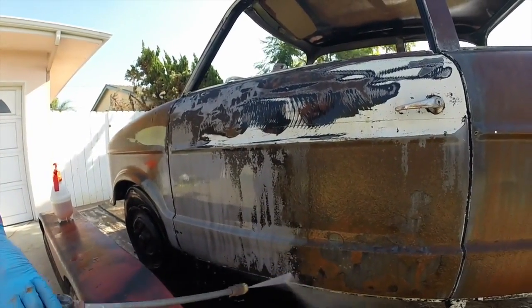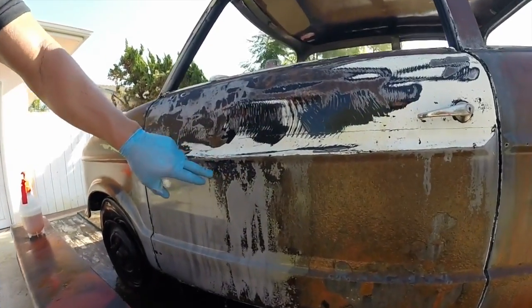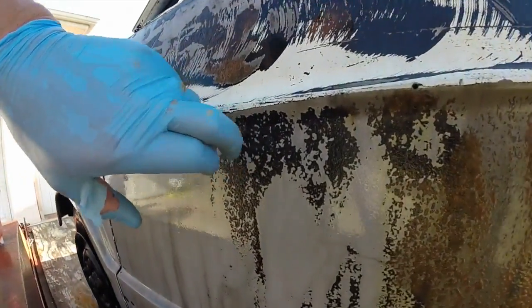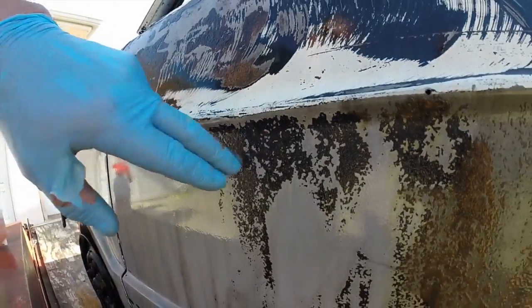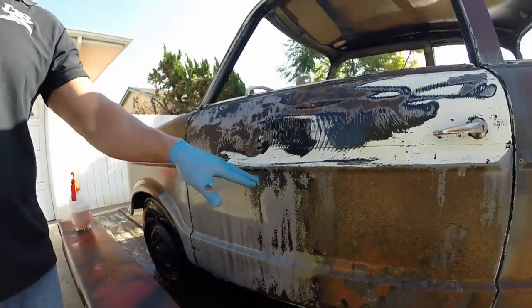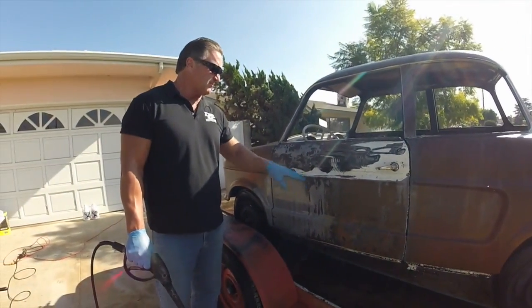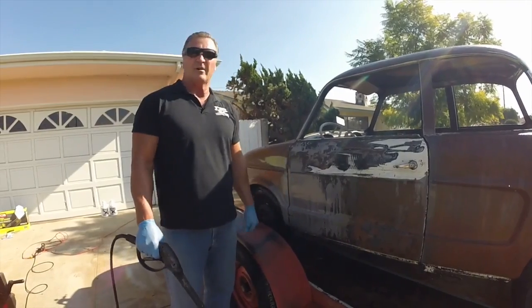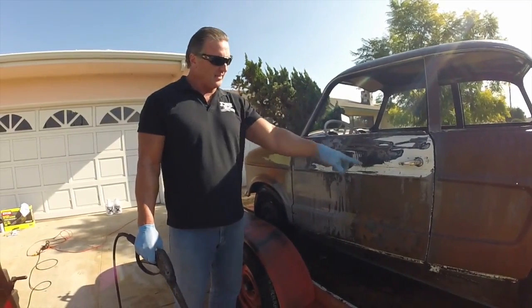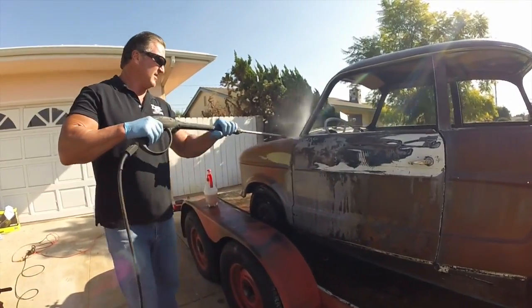You can see the really hard pitted places that are really corroded with rust, which are right in here. Okay, if you get a close-up, it's really rough. What we're gonna do is clean the whole car off, and all this stuff is what I was talking about, where you spray it on there and just let it sit on that spot. And then just work this spot, work this spot, work the spots that are heavy, and then we'll come back and finish those up. And when you're done, light coat the car, whatever little piece of rust on it, it's done. Your project's finished.